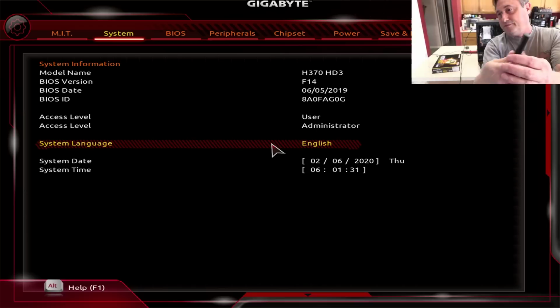And I'll just hit the power switch, shut this down, reach around here, plug it into a blue USB port, no network, no internet, just keyboard, mouse, power and monitor, and the Windows 10 installation media. No other drives are installed, just the drive I want Windows 10 installed on, which in this case is the only drive this computer has.